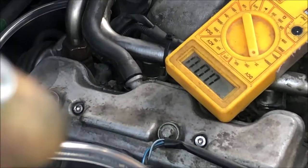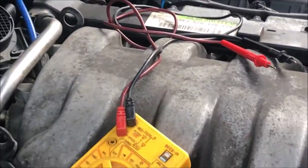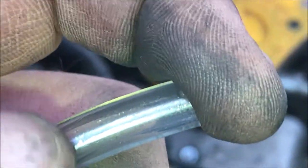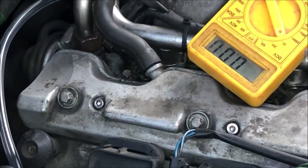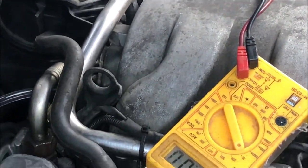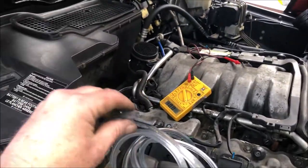You can probably hear it. I'll put it by the speaker. I don't know if you can hear it or not. Trust me, I can hear it sucking. See it sticking to my finger. We are getting vacuum. That little vacuum port there where it goes into the intake manifold. Wow, there we go. That might be plugged a little bit, still a tiny bit,